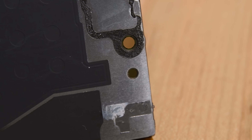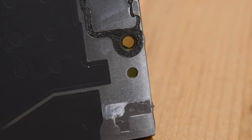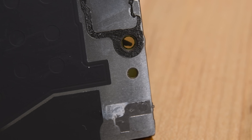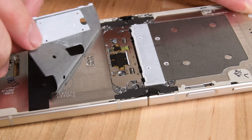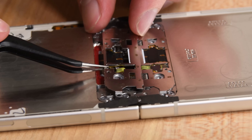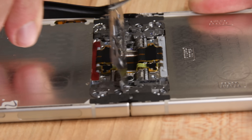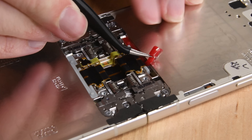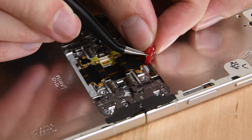One more neat Z Fold display thing — this is the front-facing camera hole. The dots you can see are OLED pixels, just more spaced out than the rest of the display so the camera can peek through. Now, let's look under the Z Flip 3's screen. Last year, underneath these stickers, the hinge and cables were exposed. This time, a pair of extra metal plates guards them. The plates are attached to these rubber strips, and under these rubber strips is the goop I've been looking for.